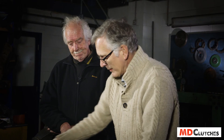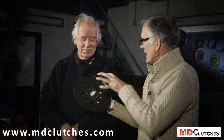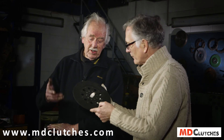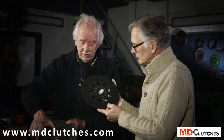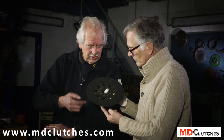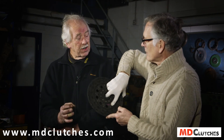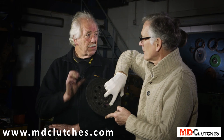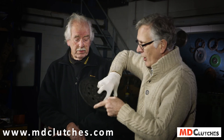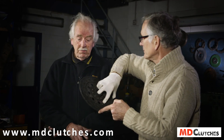We end up with products like this coming in covered in dust and oil contaminated. We can tell from this exactly what's wrong with the car. If you look at this one here, it has grooves in it — dust grooves really. Half the grooves are missing on that side, and on the other side they're missing on the outside, but the inside is still almost original. If you physically measure it, you'd find the outside has been reduced substantially compared to the middle, telling you it's only been working on the outside. So we can tell owners whether they're riding the clutch too much, whether their flywheel is dished, what condition it's in, and whether they've got oil or grease contamination.